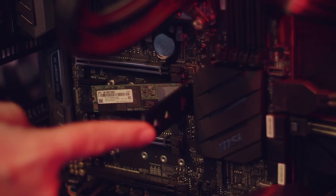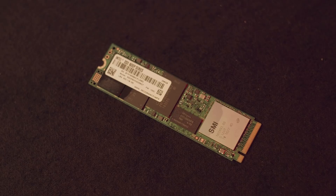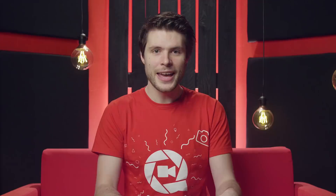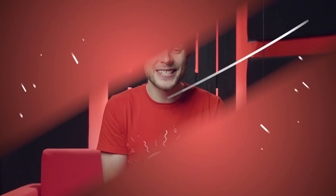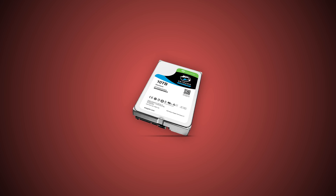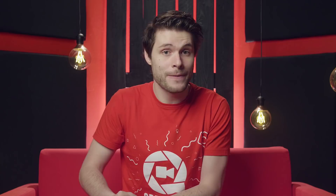For an even faster experience you can go for an M.2 SSD — these are chips which install directly onto your motherboard and have tremendous speed. Our system came with the Intel 600p M.2 SSD of 256 GB, which is enough for the operating system and all applications, with read speeds up to 1.5 GB per second. As for the media drive, we got the Seagate Barracuda Pro — a 10 TB drive designed for creative tasks, running at 7200 RPM, which eliminates any delay during rendering. You can also go for a 5400 RPM drive if that fits your budget better. Remember, you don't need an SSD — it's a luxury. Once Windows is booted and your editing programs are open, you won't notice much from having an SSD anymore.